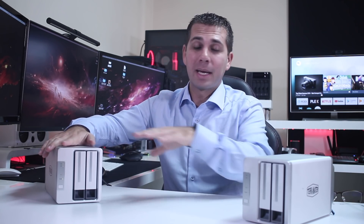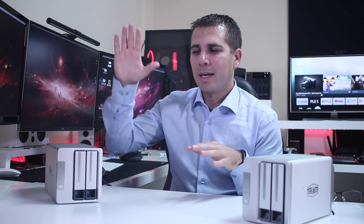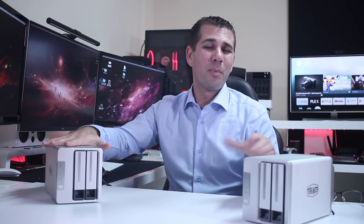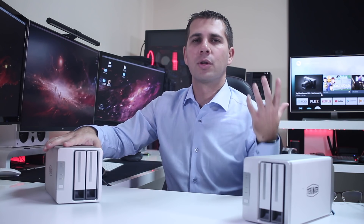Inside your network you can expect it to work great — streaming to five or six machines with no issues, just keep your home network bandwidth in mind. If you plan to stream Plex movies outside your network, that is a very taxing task for the CPU, and you can expect one or two streams maximum externally. For more external streams you'd need a NAS with something like an i7-8700K; with lower-end CPUs it will be difficult, and this applies to almost all NAS units.